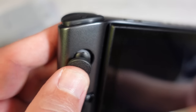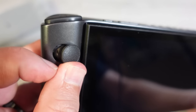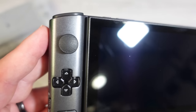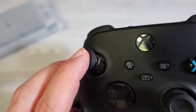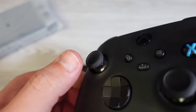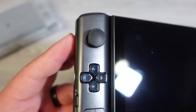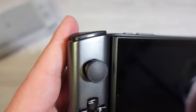The analog stick seems not completely finished. Traditionally these things should have a bigger skirt to protect the innards and keep out dust. I'll talk to GPD about that — if they're still making these, I would really prefer them to be concave like Xbox 360 analog sticks. Looking at the new Xbox Series X, you can see that when you move it around the skirt doesn't show anything on the inside, and the texturing around the rim plus the concave shape gives your thumb a nice place to sit and hold on better. I hope GPD makes them concave and produces a bigger skirt.